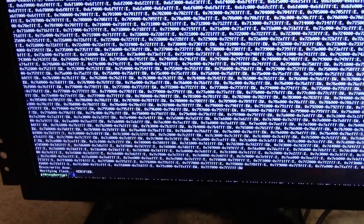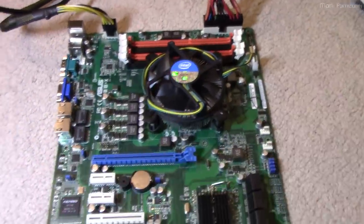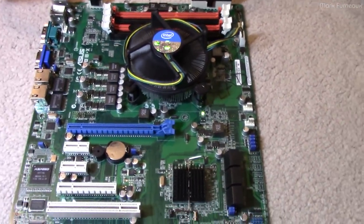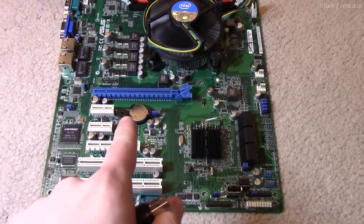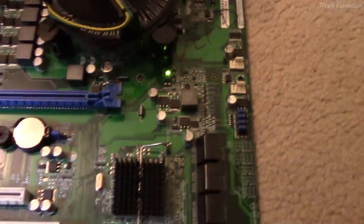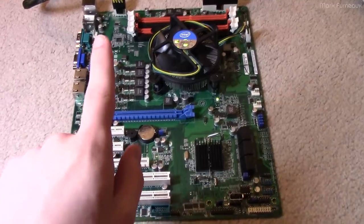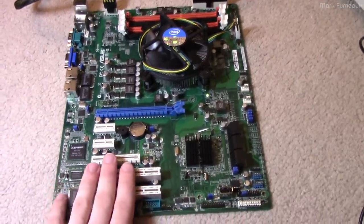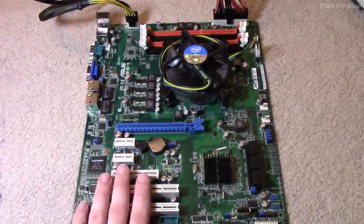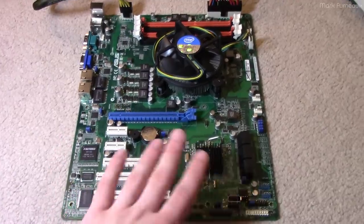It's been verified. I've taken the chip out, put it back in the board, and I'm not even going to bother putting the memory back in. Let's fire it up and see if this has made any difference. We have a difference — we have a beep code! That's one long, two short. I need to look up what that means. Pretty much if you Google beep codes you're going to get a bunch of stuff that's completely wrong, because most of the beep code lists online are from boards from 1992 and completely irrelevant for modern BIOSes. I'm going to have to go specifically to Asus's documentation.